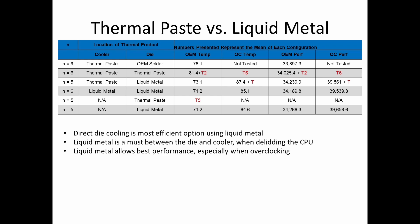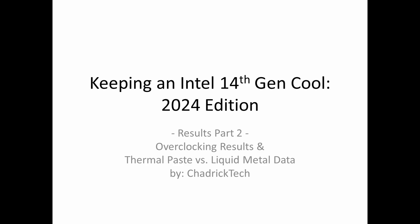It can stay in the gas, so to speak. The cooling is most efficient if you use liquid metal — liquid metal is a must, in my opinion, between the die and the cooler when you delid the CPU. If you're going to do that, just accept that you should use liquid metal, as it allows the best performance especially when overclocking. I told you it wasn't going to be a long video, but I wanted to make sure you had all that information. Next videos to come will look at the products themselves — exactly how I used them, how I set them up, how I had to change my mounting if needed, and my overall impressions of swapping these things out multiple times, how they held up, and what my concerns might be. There are a few, but overall these are some really good products. Hope you found this helpful, and stay tuned for more.